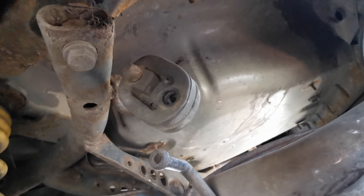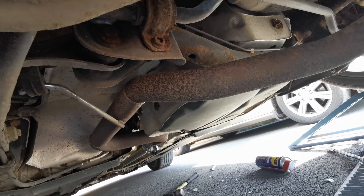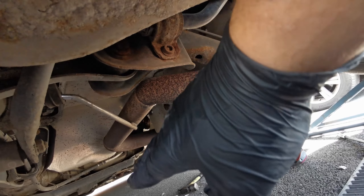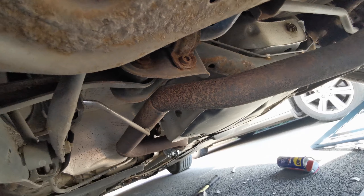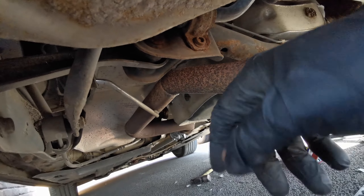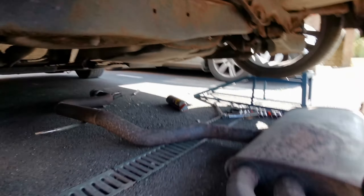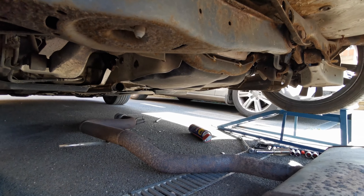I haven't actually done that today — I'm being a bit lazy. One more to do, which is that centre link, a slide-off one, because we had the main point of the centre silencer removed. So this is custom. It looks like 12 mil pipe to go on there. I'm about to pop that off and give it a pull. Pop the exhaust off and it shouldn't be too long before we get it all off. There we go — exhaust off all the way through to the centre. The easy bit out of the way.